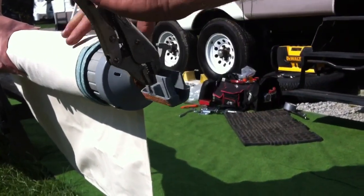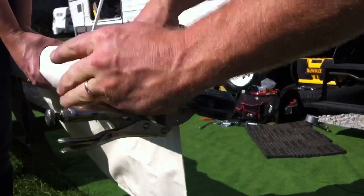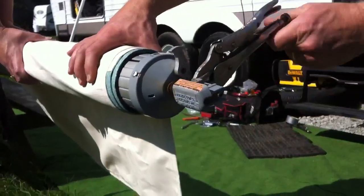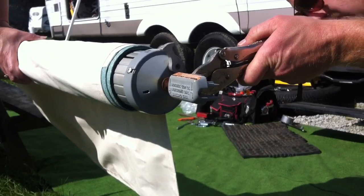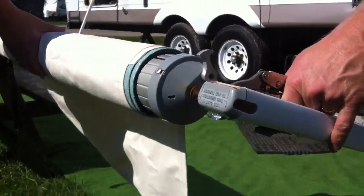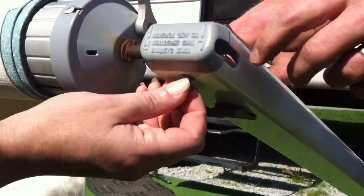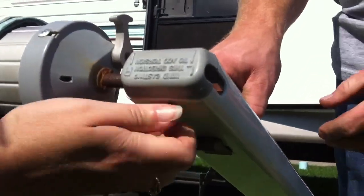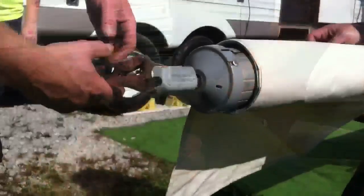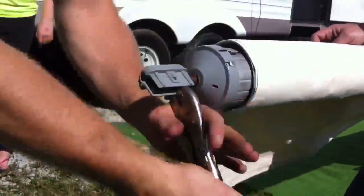Once you have the fabric wound up, the next step is to put the tension back on the torsion assembly. Start with the side with the cam lock — it'll click as you go, and follow the arrows on the end of the cap, counting the turns as you go. This one had eleven rotations for the correct tension. Once you get it to that position, hold on to the vice grips until you get the rafter rail in there and the screw in the bottom. The cam lock helps on this side, but it could be a problem on the other side because there's no cam lock. Once you get the bolt tightened, move to the other side and repeat the process counting the number of rotations.